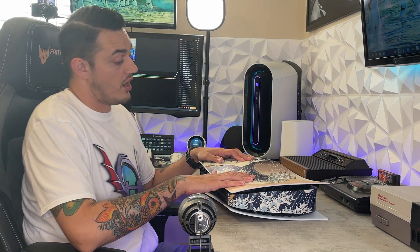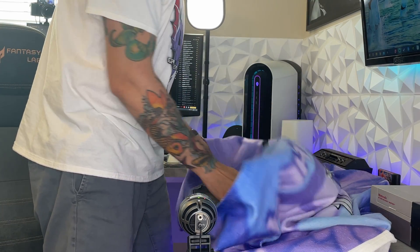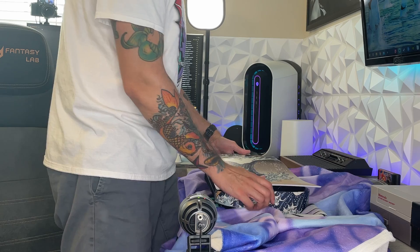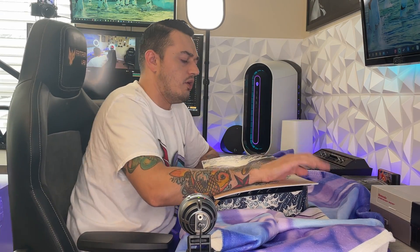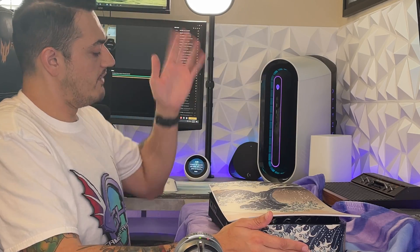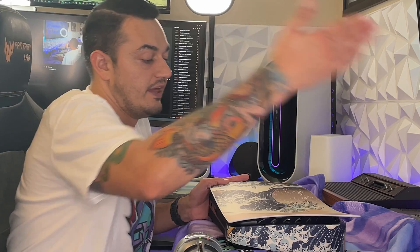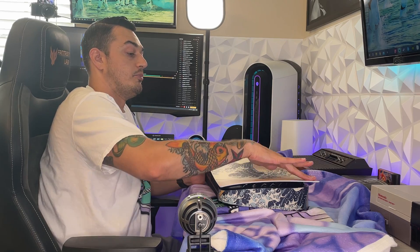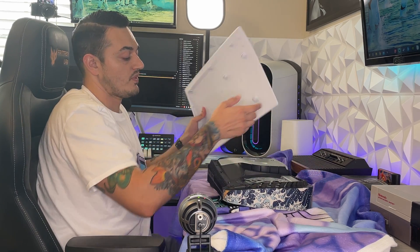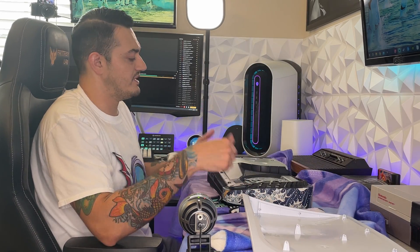You don't want to just pop the side panels off aggressively — I was guilty of that on my initial vinyl skin install and luckily didn't snap any plastic tabs. Set your console on a soft towel to avoid a slippery surface and prevent scratches. With your left hand put a little pressure near the AC adapter at the bottom left, and with your right hand apply pressure at the top right and peel — you'll hear a little snap and the panel will pop off cleanly.